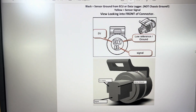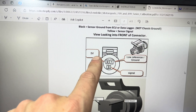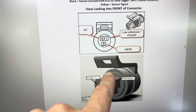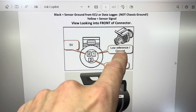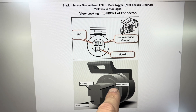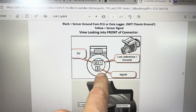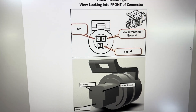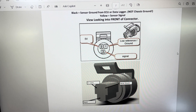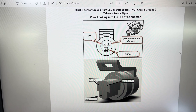All you have to do is go to whatever pressure sensor you're using and look at their diagram to make sure you get your wiring correct. All pressure sensors are going to have a 5-volt reference, which means you have to run 5 volts to pin two. Your ground wire — also referred to as a sensor ground — is not chassis ground, not battery ground; this is sensor ground, so it has to go to a sensor ground in the ECU. If you ground it to chassis, it will not work and you could burn your ECU up. Pin three is just your normal signal wire that runs to your analog input. That ground wire is what gets people confused — remember, it is a sensor ground, not a chassis ground.